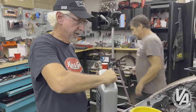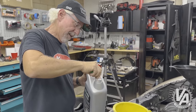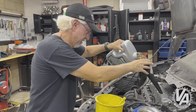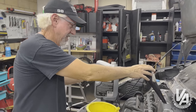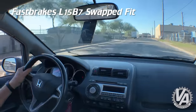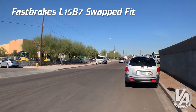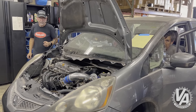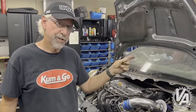Normally I would use Honda Synthetic but I was out, and I needed to fill it now — I didn't want to do it on the trailer tomorrow. The reason it starts but doesn't run is because we haven't flashed our ECU yet. So what happens is when you turn the key on, it primes and acts like it's going to start. But then the immobilizer sees you don't have the right key, so it doesn't really run — it fires up and then dies almost immediately because the pump's turned off. But we're ready to go to the Honda dealership, get it reflashed, and then we should be able to drive this thing around. Although it'll be kind of loud.